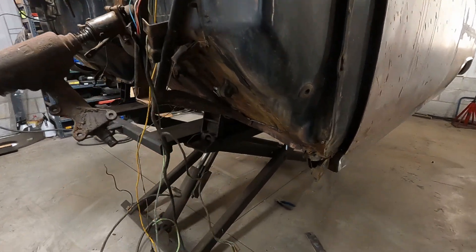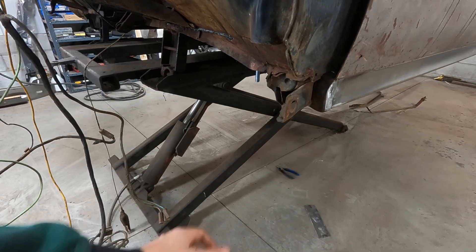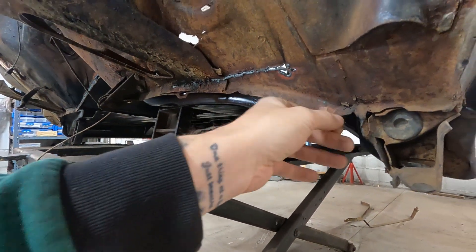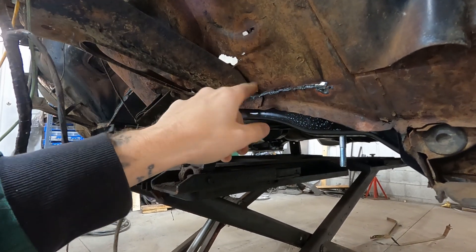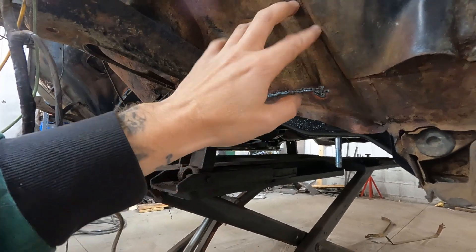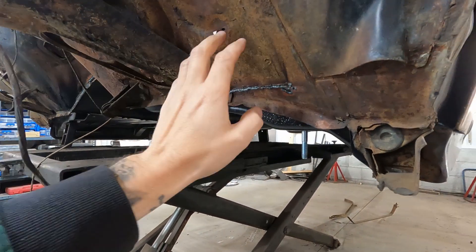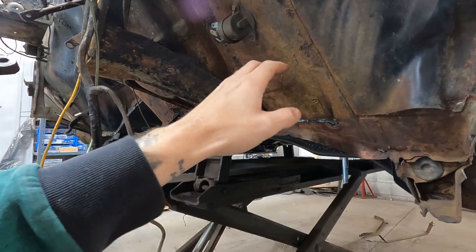Now that I've elevated the situation, you can see this side. I used the end of the rocker where it was all solid and kept the factory mount, which is good. I need to clean all this up, and then I'm going to make a new lip that goes across here, come up to here and probably across here somewhere — just a flat patch from the inside so I don't have to get into this brace too much. This was the only spot on the toe board that's pretty rough, and I don't really want to replace the whole thing, so I'll just make something.